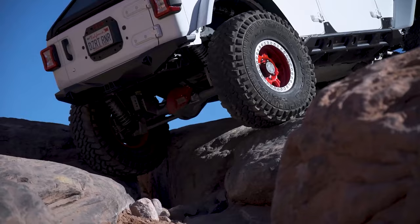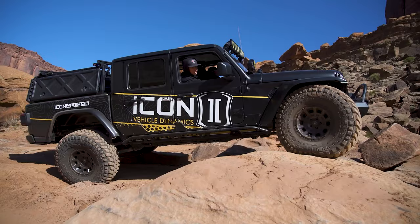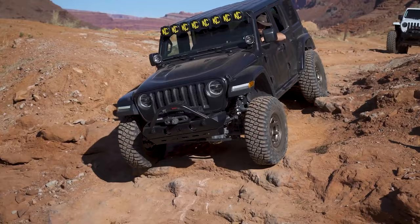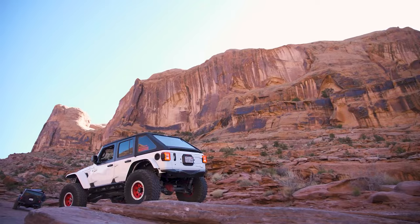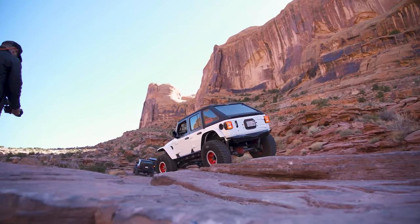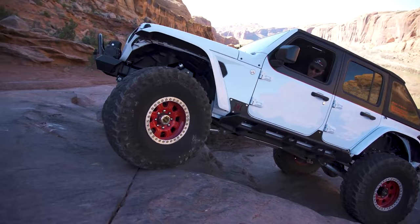Just like holding up the wheelbarrow as more weight was thrown into it. Some of you watching who don't run any sway bars on your off-road vehicle know exactly what I'm talking about. Simply put, a sway bar is a torsional spring that connects to both the left and right sides of the suspension to reduce body roll. When both wheels take a bump equally, the wheels move the same amount without twisting the anti-roll bar. Individual wheel movement or body roll will force the bar to twist as the lever arms are moved, thereby adding the bar's own spring rate to that of the vehicle's springs.